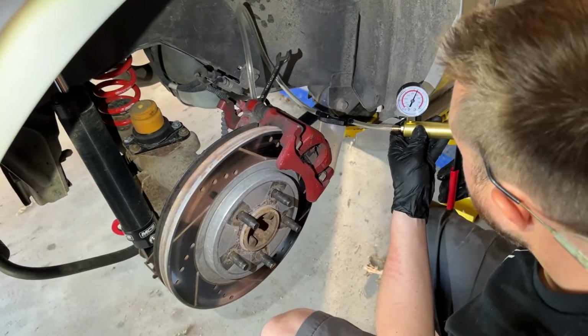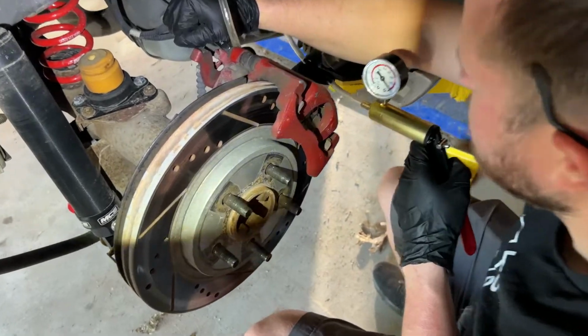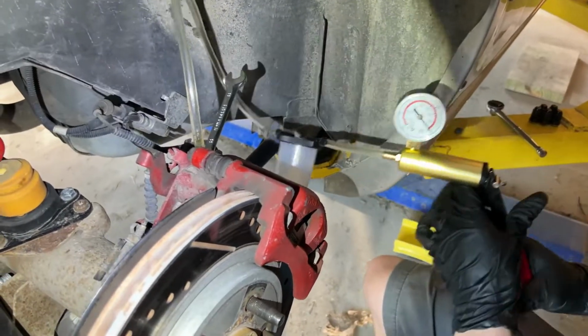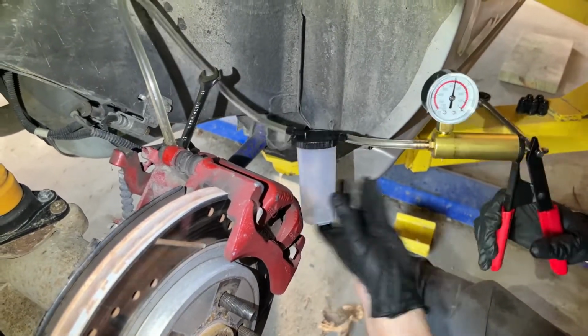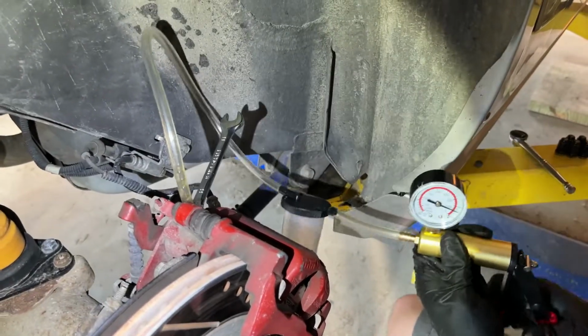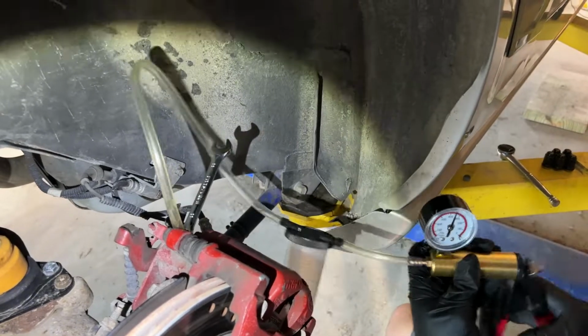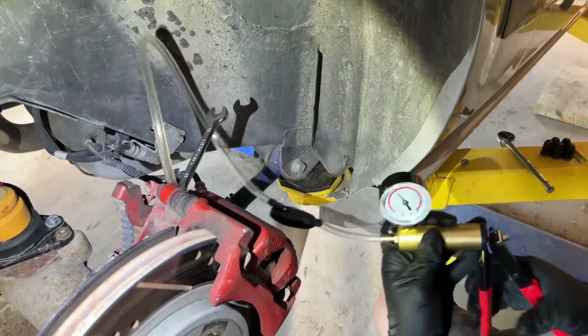So now Dan's pulling fluid out of the actual brake line and the caliper. Well, hopefully, there it comes. You can see, once he starts to suck on that, it come out of the fluid and fill that plastic reservoir in his left hand. Takes forever. Yeah. Might have you pump, sit in the car and just do pump and hold. Okay. So what Dan means by that is that currently what he's doing with his hand is pressurizing the brake system, which I can do way easier just by getting inside the car and pushing the brake pedal.